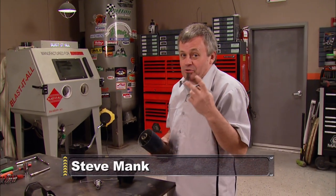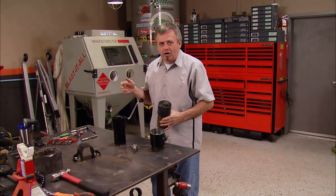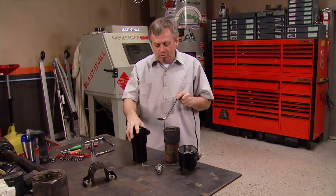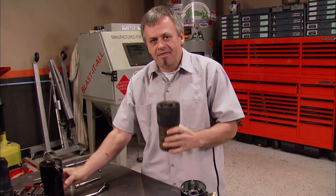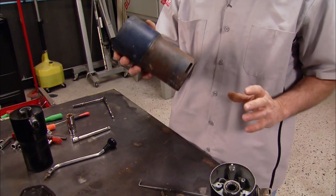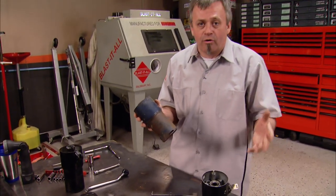Now that you had to watch that painful display of me tearing apart two old steering columns, here's what we were chasing. Our original column in the car was an automatic with the selector up on the column itself. We're going to eliminate that because we're going to have the car with a four-speed system, which means we wanted to get rid of this tower and make it smooth. This correct piece is smooth all the way around and is the right part for a floor shift car, whether it was an automatic with a console or a four-speed.